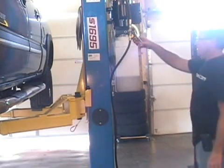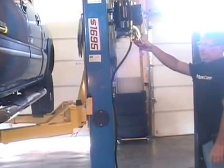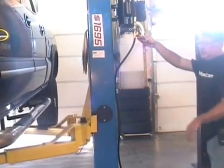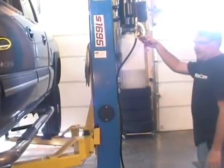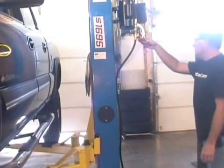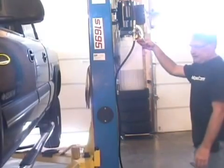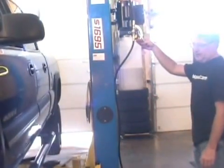We've released the safety. Now we're just going to push down on the release handle and down it comes. Make sure before you lower the lift you don't have tools, blocks of wood, a jack stand, or anything like that underneath it. I have seen people knock items off the lift because they forgot to remove their toolbox or jack stand. Verify there's nothing blocking your way down.